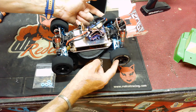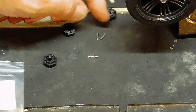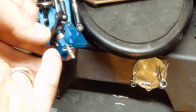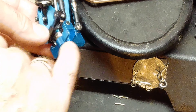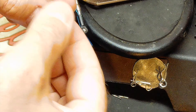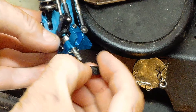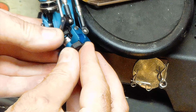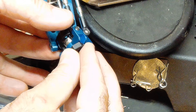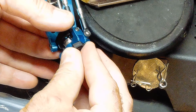I took the hexes apart and this is where it gets interesting. Every single hex pin I took out had a considerable bend in it. Every pin through the drive shaft had been bent and folded forwards — literally all of them. What had happened is the plastic hex was being forced against the inner hub carrier. It's like putting a disc brake on — the tighter I tightened the wheel, the harder this thing was getting squeezed against the inside, simply acting as a brake.